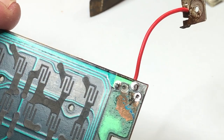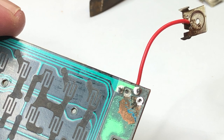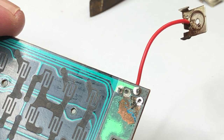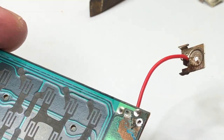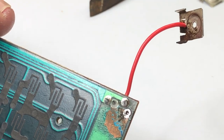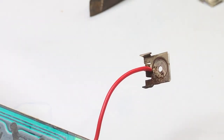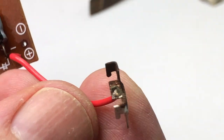I've got this hole cleaned out and when I dabbed some white vinegar on it, it bubbled — that's the chemical reaction. That showed me there was still alkaline goop down that hole. So if I had just shoved another wire through and re-soldered it, that stuff would have just kept on eating away. So it is not quite as simple as it seems to get rid of it all. But I think that hole is now dealt with. The other one looks okay — there's no evidence of wicking up that hole. The joint looks good. That's the original wire and it looks okay. I am going to disconnect it at this end because I'm going to have to deal with this rust, but let's get the negative terminal reattached first.